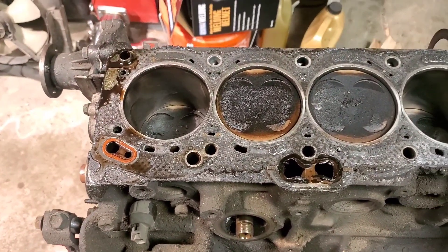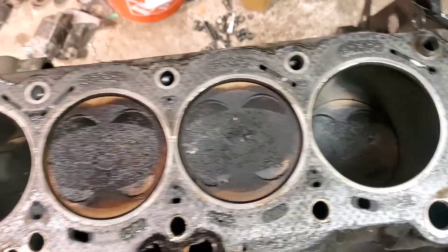It's been a little bit of time, but that's only because I'm being really careful with all my bolts — just don't want to mess anything up. Got the cylinder head off. Cylinder 2 has some gnarly carbon buildup, more than any of the other cylinders. And flipping the head over, the valves look kind of the same way — they're pretty gnarly. But at 290-something thousand miles, that's close to 300,000 miles. If you factor in how I drive it, physically the motor's got 290,000 but mentally she's got a lot more than that. The head is off and I'm going to take the caps off the valve springs and then clean up and call it a night.